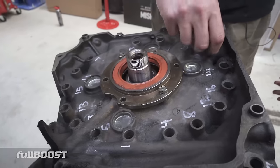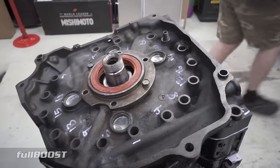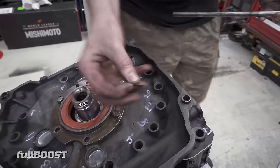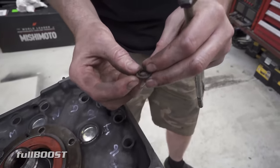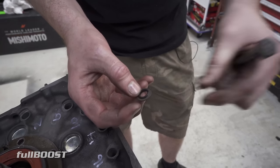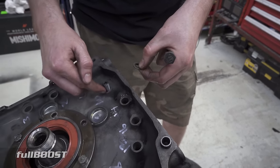Then we'll be ready to whack the nuts on. Normally these bolts would have an O-ring — tension bolts have this little O-ring to seal them in place. But because these factory tension bolt O-rings are only for the M10 threaded stud, they won't fit this half-inch stud. So what we actually have to do is put RTV around here and then put the bolt in place. It may look like a bit of a backyard operation because it's just RTV, but it works really well and you'd be surprised how many workshops actually run with that process.